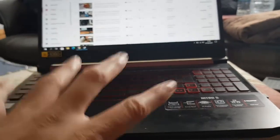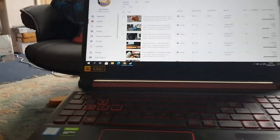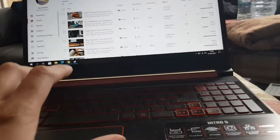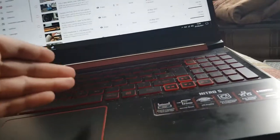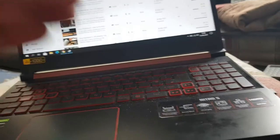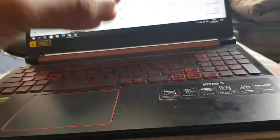For now I'm going to open the laptop up, give it a good clean, and show you what the Arctic MX4 paste looks like after about three and a half to four months — whether it's pumped out or anything. With the Cryonaut I just used a tissue to clean it off, but this time I did a proper clean, so the surface prep was better. Despite that, it performed worse.